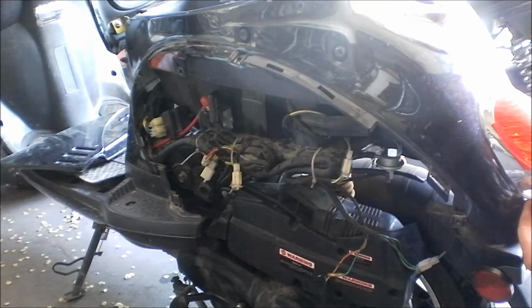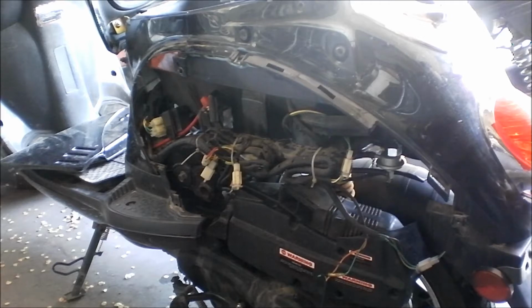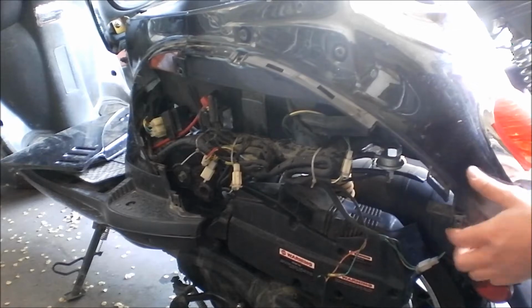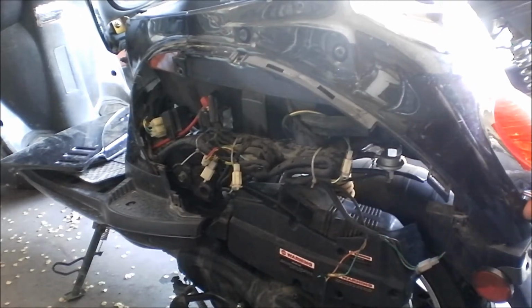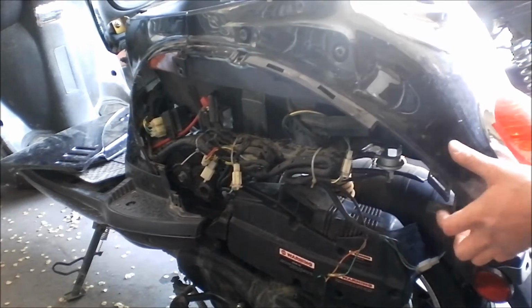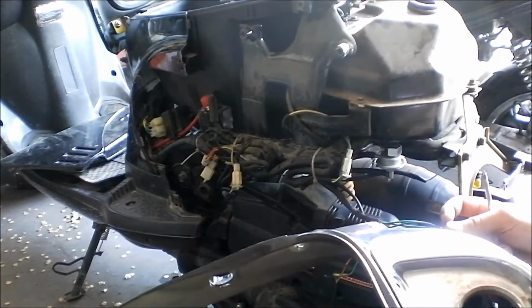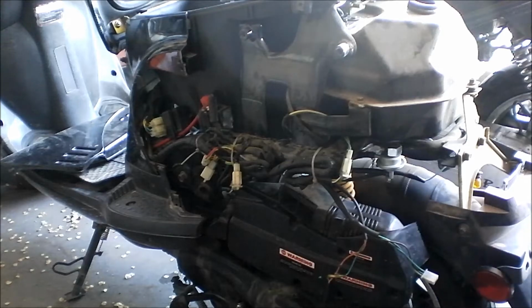And the problem is sometimes after you get it to start, whether it's beautifully or having problems starting it, and you take it for a run, it's real fast, real nice. This is probably the quickest scooter I've actually been on. I've got my 150 right next to it. But it's really strange because one second it'll be zooming right along, and then it'll act like it's starting to get less and less fuel, or it'll just shut off and not start, and then you have to have somebody come and rescue you, which is rather annoying.